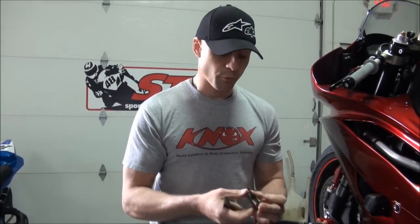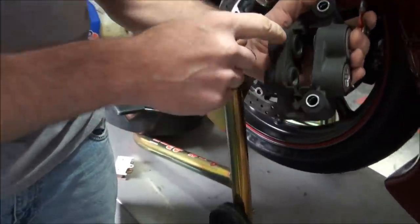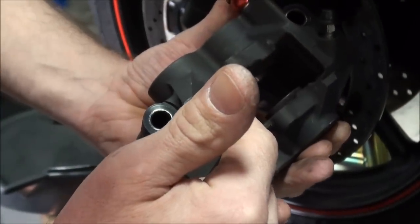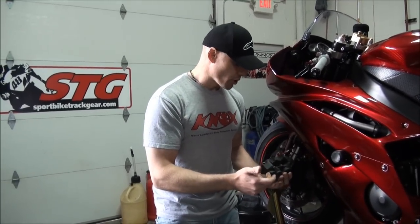Stock brake pads are really pretty good, but with 10,000 miles and all those heat cycles, it's just like a tire — it really affects performance. One of the most key things here: zoom in and look at all the brake dust on those caliper pistons. What you do not want to do is just force these pistons back. There are two reasons for that. First, any debris stuck to the caliper piston right now can be pushed past the dust seal and end up between the square-cut seal and the dust seal, which can damage the caliper. Second, brake fluid is hydroscopic — it attracts and retains moisture, and like any other oil, it wears out. You'll have a little bit of debris and floaties inside the fluid. If you just push the pistons back with the system closed, all that garbage fluid and debris gets forced up into your master cylinder. The last thing you want is an issue with your front brake system — master cylinder and/or caliper.